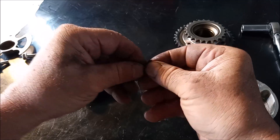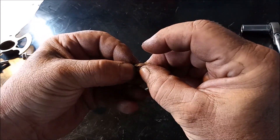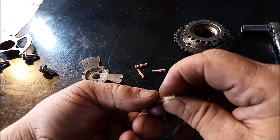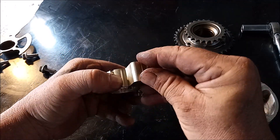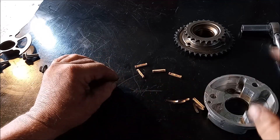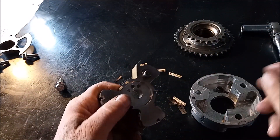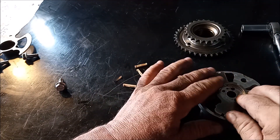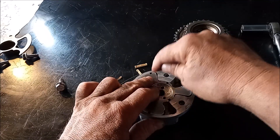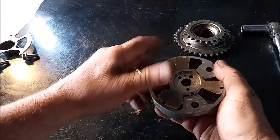The sliders are a little bit tedious — especially with old arthritic fat fingers — but you can get them into place if you work at it enough. The spring part goes against the body of the rotor, and the plastic piece, which provides lubrication, goes against the inside of the body. Nothing special about this pin — it has a nice clean action. When you rotate it, provided that there's downward pressure, it locks in place. Oil pressure coming down in there pushes it back up enough so that the rotor can be lifted and rotate.